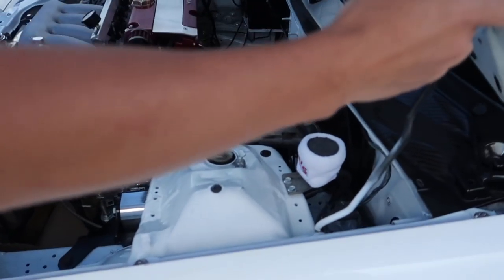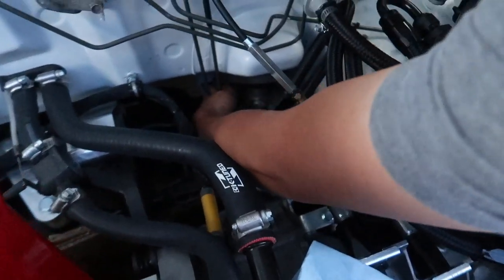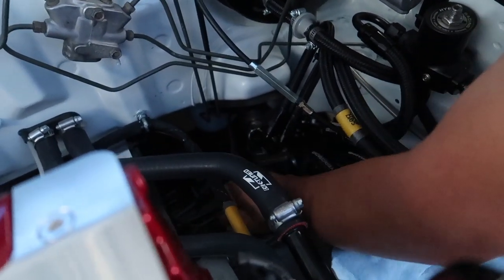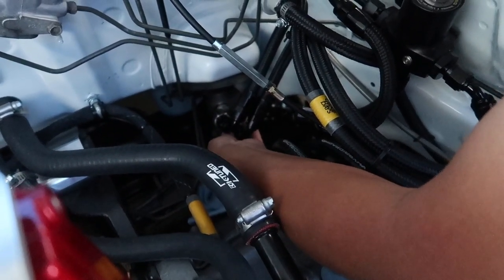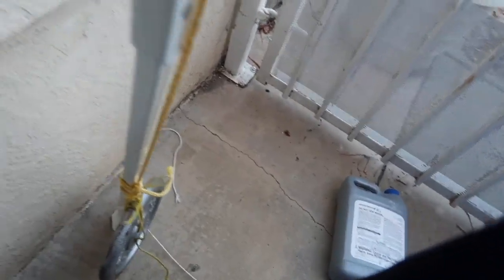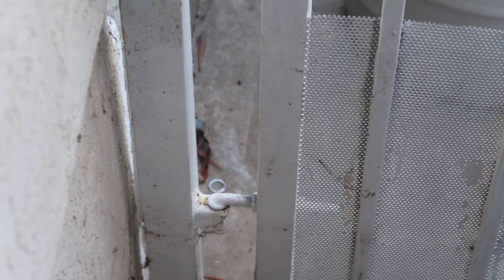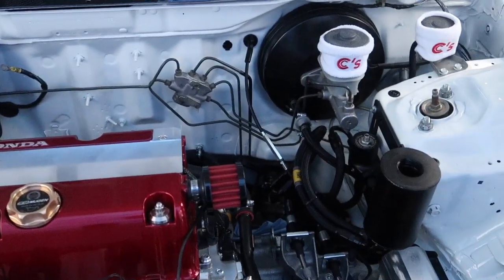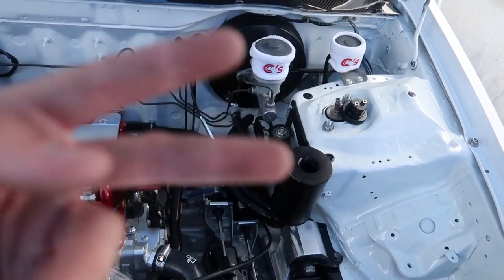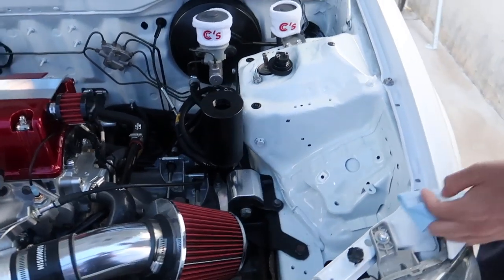Now to check up on the leak. Is it still leaking? I left a rag underneath. It was dry. How about the front? Dry. It's dirty but it's good — so the O-rings work. They gave me one little crush washer with the kit and it got warped putting it in, so I took it off and used O-rings like what you'd use for fuel — and it's not leaking anymore. It's full. All leaks done.